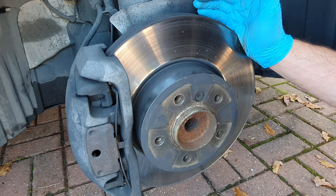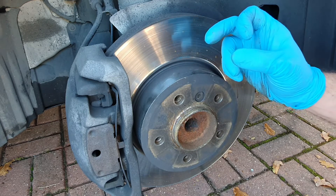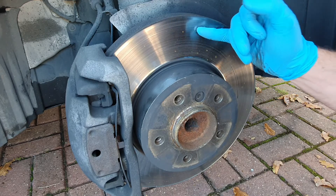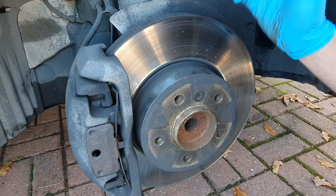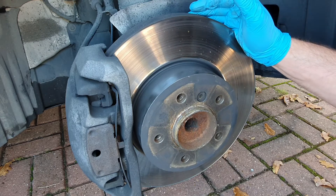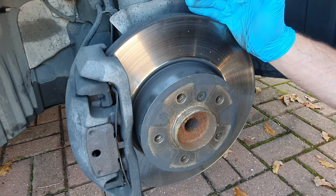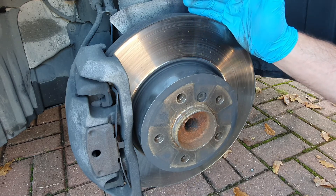You could also have horrible scratching or screeching noises, which is probably a sign that the pads are down to bare metal - really bad news. Sometimes the brake pads themselves have a wear indicator, which is a small metal tab that comes into contact with the rotor and makes a squealing scratchy sound. And if your car is fitted with brake pad wear indicators, you'll get a notification on the dash saying the pads have worn down.